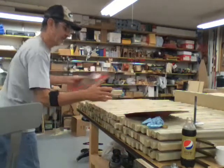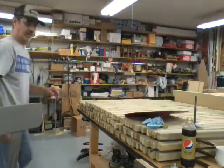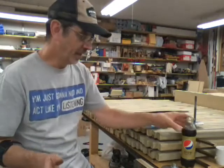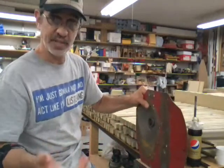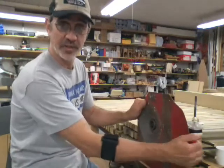Now to get the bushings in and out of here — I can take them down to my shop where I work, I have a 12-ton press that'll pop these right in and out with no trouble. But what do you have at home? Probably not a press. So what we're going to do is stick this in a vise. Most everybody has a vise. If you don't, you're going to need somebody to hold this for you, otherwise you need three hands.